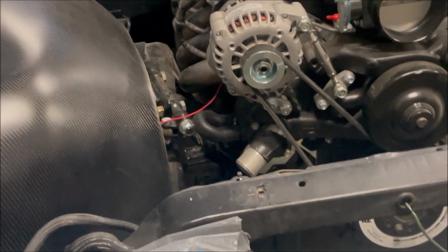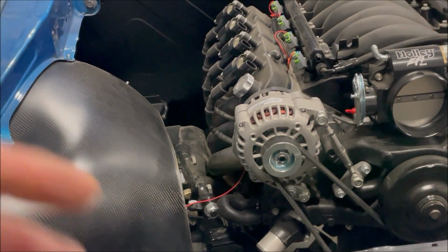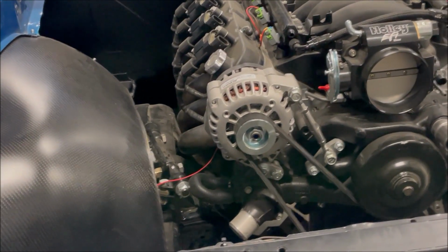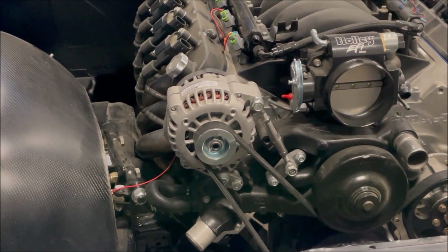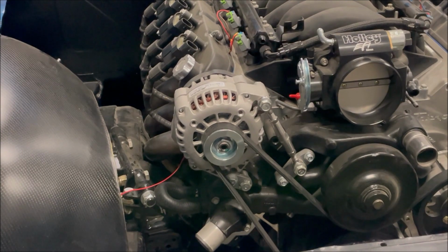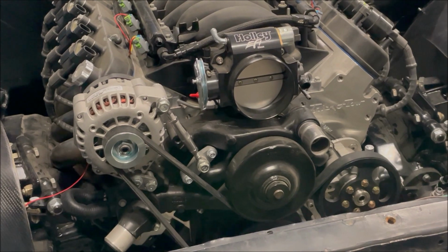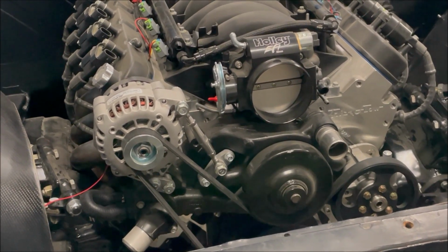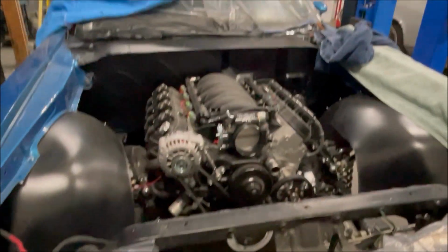Which was really tough because I had to unbolt and get those mounts out. It uses the factory style clamshells on the frame, and then the Holley mounts go on those. I marked them up, slotted them, and then welded up part of the hole. That got the engine at 3 degrees rather than 4 degrees, so it's at a better angle. It also made the T56 Magnum fit in the tunnel a lot better, and it really didn't affect much.